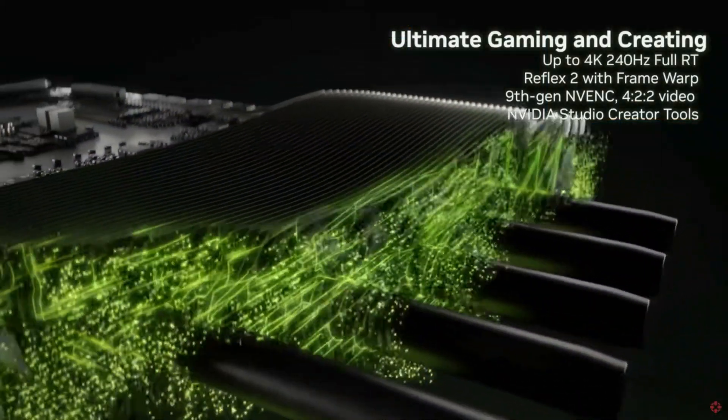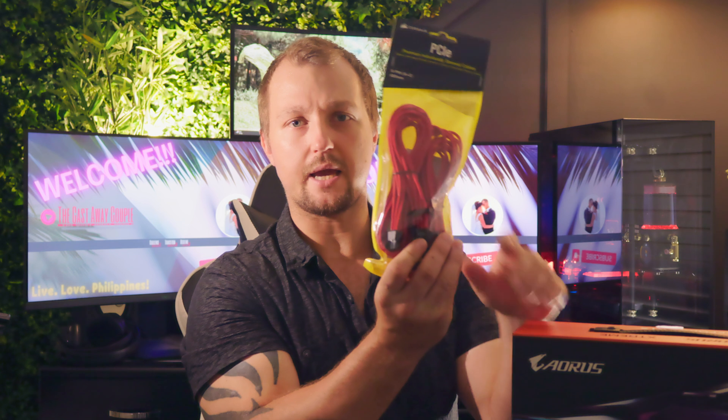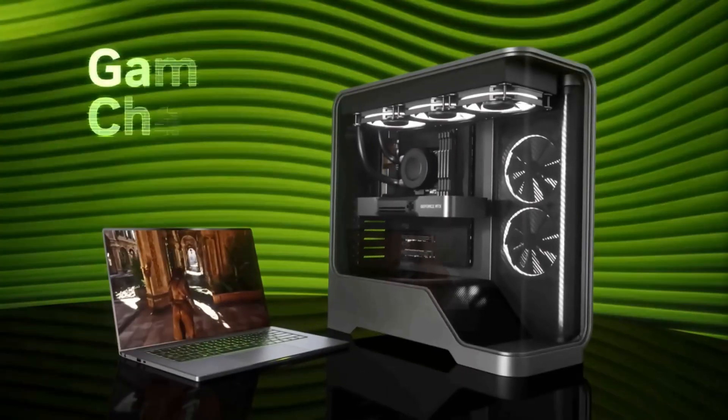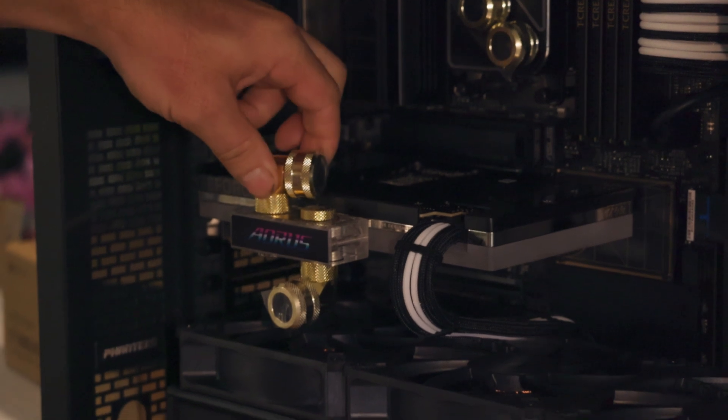So why might this happen? It's hard to say exactly, but it seems like something about the sensor pins in the new 12V High Power standard might be finicky, especially with the 50-series cards. Even though my CableMod cable was apparently designed for ATX 3.0 and 3.1, somehow the old-school PCIe cable — the three 8-pin connector — worked flawlessly. My theory is that some custom cables might not properly signal power delivery to the GPU, especially if they skimp on those additional sensor pins, and the adapter might act as a more stable bridge. PC building really is half science and half witchcraft — sometimes you just have to laugh when your $2,700 GPU won't boot because of a cable.